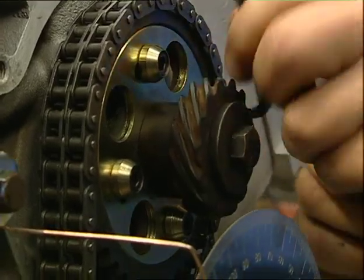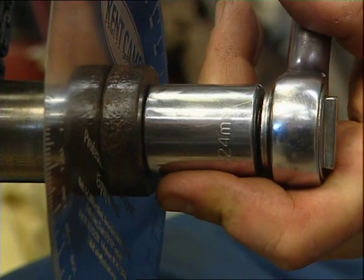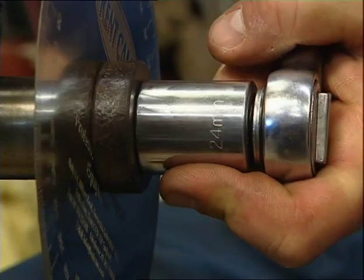Tighten them up — now I need to check and adjust. The checking is straightforward: move the crankshaft right round to 10 degrees before the expected maximum — that's before it should be at the top — then on the dial gauge measure what we have. Then take it 10 degrees the other way, hopefully past the point of maximum lift, and see what it measures again. If it's exactly the same we know 108 degrees must be bang in the middle of its dwell angle. It is all a bit complicated, but just a bit of checking.